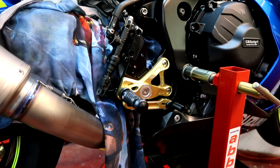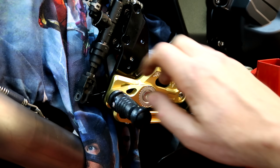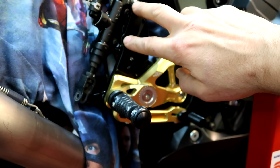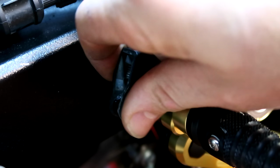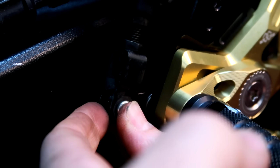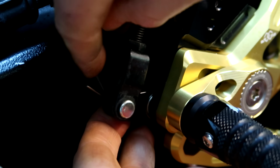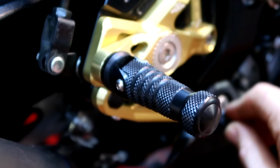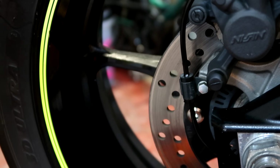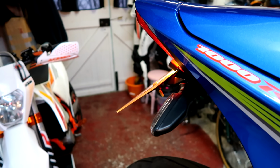Okay, getting there now. So mounted. The spring's on for the brake light switch. The whole brake needs adjusting yet. It's got to mount it at the back here, then mount it here with the plates, guard plates, and I think we're nearly done, apart from the adjusting. Adjust that brake light switch until she's right there. Bloody brilliant.